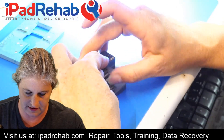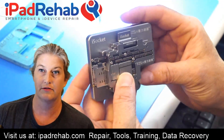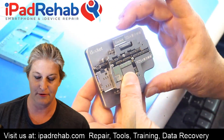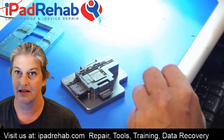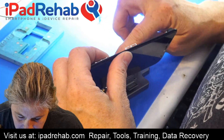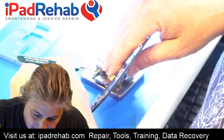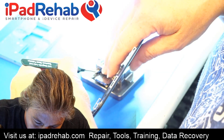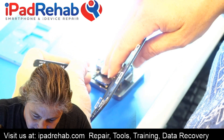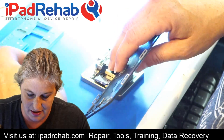I wanted to make this video since one of these has come up. So that just kind of snaps into place. This one is called the iSocket. We're going to ultimately try out a few of these, then we'll make the iPad Rehab pick and sell that in our iPad Rehab supply store in our iPhone X collection. Now let's try it — this logic board should be a working one, so I'm going to attach the screen. This is a known good screen, and what I really want to get to today is a test to see whether or not we can mix and match an iPhone X main board with a different iPhone X RF or baseband board. Can we mismatch the top and bottom boards and then use iOS 12 beta 1, which ignores baseband, and get one to boot?